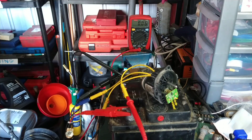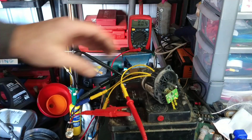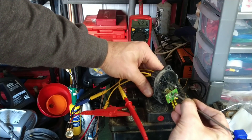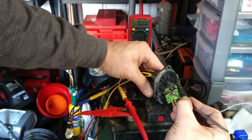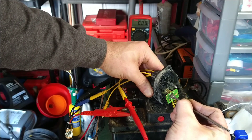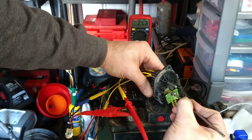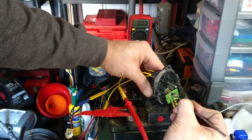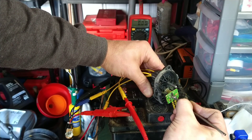Using this magnet to do the same job that the magnet in here would be doing if it was in the right place and all connected. I'm going to go in a circle around here. As I go around the outside of that chip, you can see the voltage changes — I'm circling in a C shape, so as I go around it's dropping. If I go right around, it just starts again; it doesn't keep counting up. It goes to zero, kind of down at the bottom.